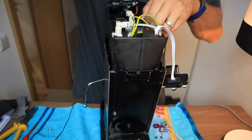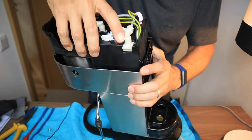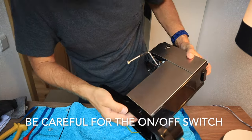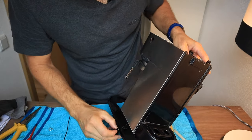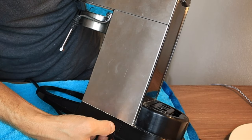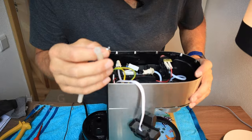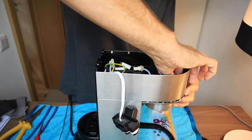Now all we have to do is put everything back together the way that we found it. I did clip off just a little bit of my hose here because it had a couple of small rips in it. So I'm going to install the hose, put the cassette back in, and put everything back the way that it was. Now that we have this mounted in there on the white nut, we can slide the cassette back in. Be careful here for the on/off button. It's important with this hose to put it on after doing the cassette, because otherwise there's not enough room for the cassette to slide down into place. Let's go ahead and put a couple of screws in for the group head so that it will stay put. Those are the six screws for the group head.